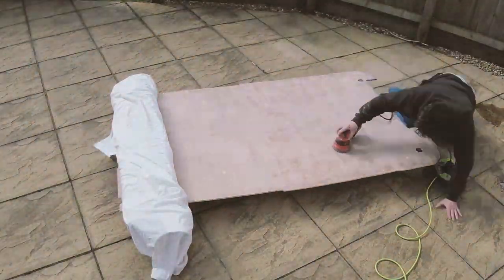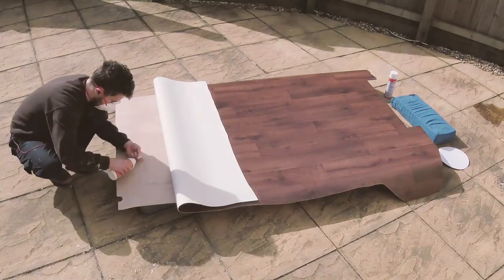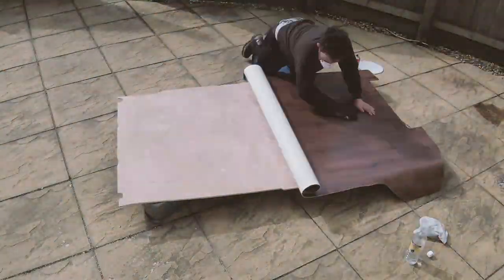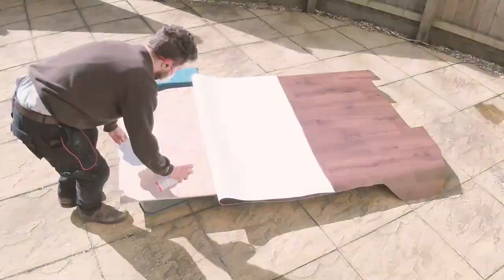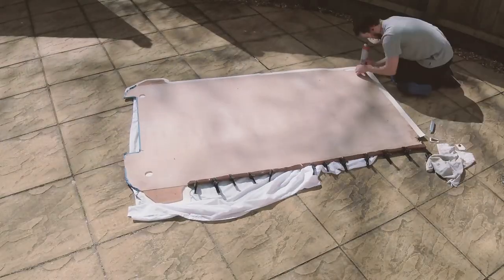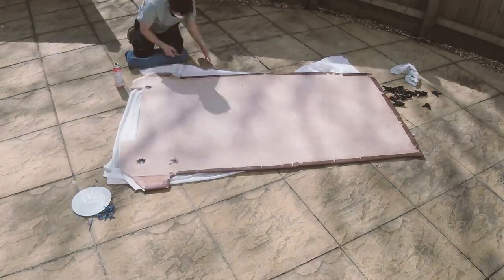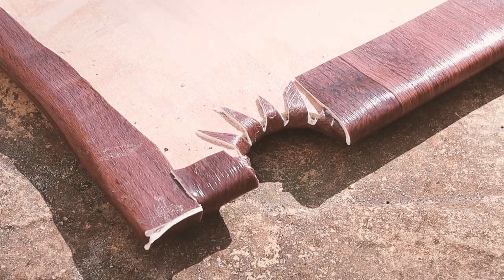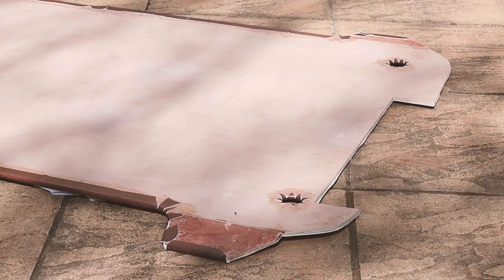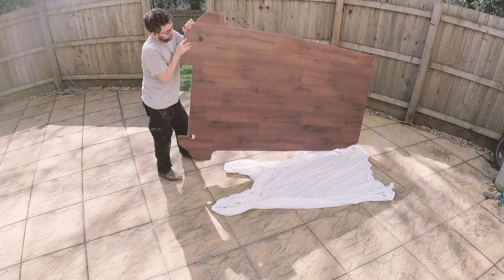When I next came back to work on the floor, my first task was to peel off the vinyl from the wood and to sand the old adhesive off the wood. As it had worked so well when I was making the door pockets, I thought I would give Everbuild Stick 2 contact adhesive a go with the vinyl. It turned out to be the right decision and immediately gave a strong bond, which I was very pleased with. Working in sections, I made my way along the ply using plenty of adhesive and applying lots of pressure. The vinyl developed a couple of air bubbles towards the end, but these were soon worked out. With the vinyl successfully stuck down, I turned the floor over and first stuck the two edge pieces in place, then trimmed the margins around the edge to their final depth, roughly 5-10cm, and began gluing the edges to the back of the plywood. If I encountered a curve in the ply which would cause a twist or bump in the vinyl, I would cut the section out so as to enable the vinyl to sit flat once glued. When it came to difficult sections such as the load ring holes at both ends, I cut out from the centre of the holes and created triangular sections. This meant that I would get a nice finish on the top side without seeing any cut marks. Whilst the underside does look quite messy, it will never be seen and tucking the vinyl under has meant that the edge is really neat.